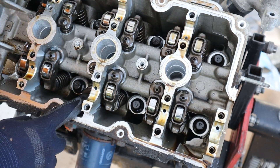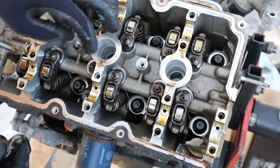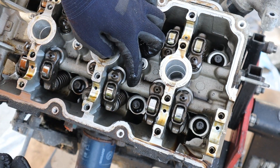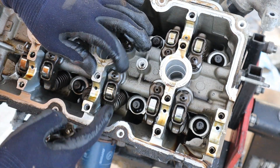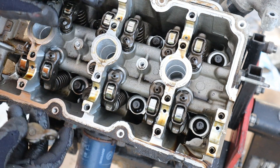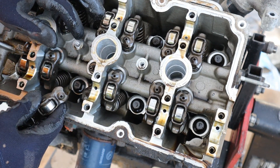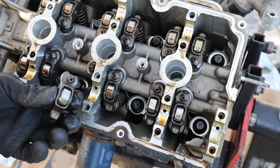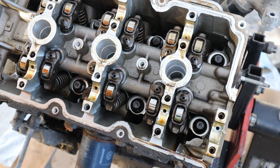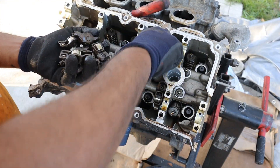The advantage here is that you've got this oil line running inside, and these lifters are going to be pushing up on this roller — so there's no issue with valve clearance and no tapping. You also don't need to do a periodic valve adjustment the way you would with a cam-on-bucket design. I'm going to remove all of these little rollers — at least you don't need a special tool to take these off.